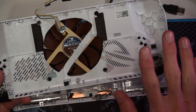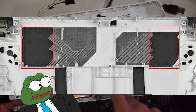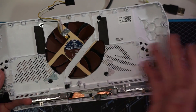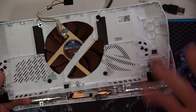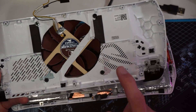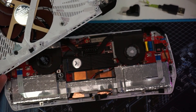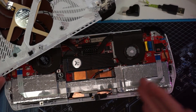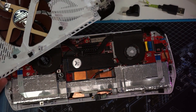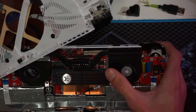If you want a free cooling mod, this is free real estate: remove the black flap here, and there's also a weird black plastic covering half of this ROG vent and a bit over here — remove those. I've seen a lot of people drop temps a few degrees just from that. Also remove the flap entirely — it's absolutely useless, it traps heat. It's just a dust shield and it does not harm your Ally. I've used it without the flap since day one and taken this thing apart thousands of times.